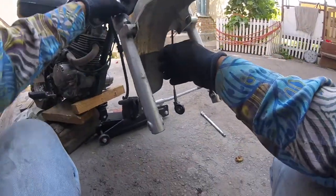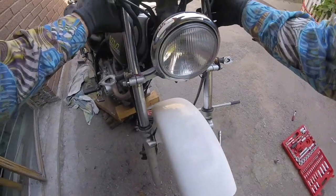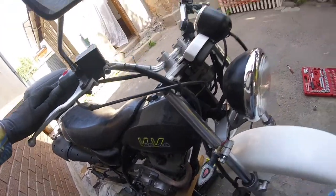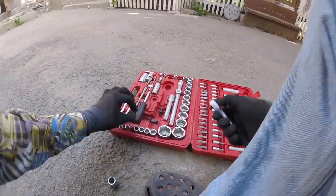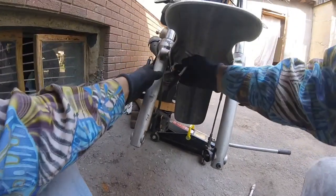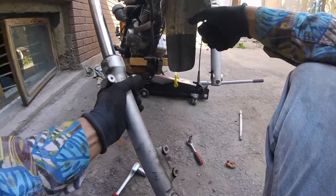Another thing: you need to remove the fender because it is attached to the forks. This one is 10mm — there are two here and two here. So these are undone. You can see the fork is already moving. I'll remove the fender before it gets damaged. Here are the front fender bolts — they have to be removed for the fork to come off. So this is the right leg.